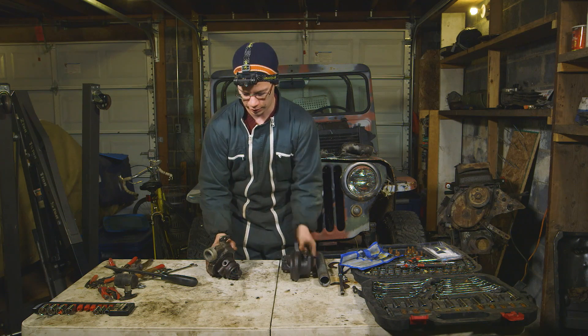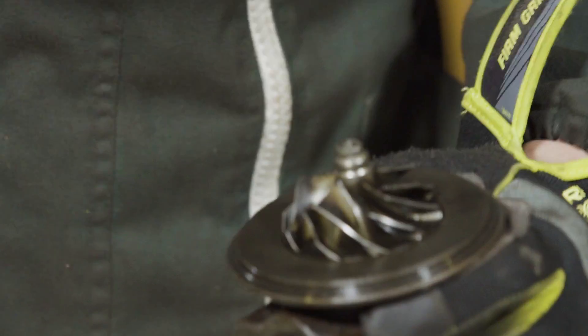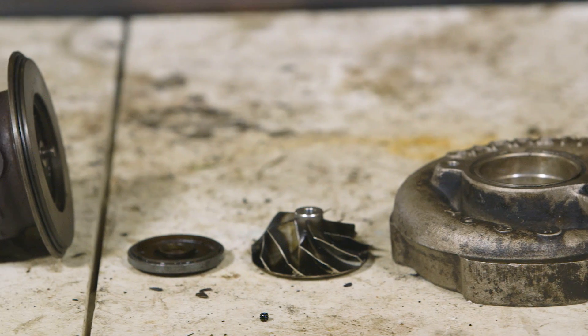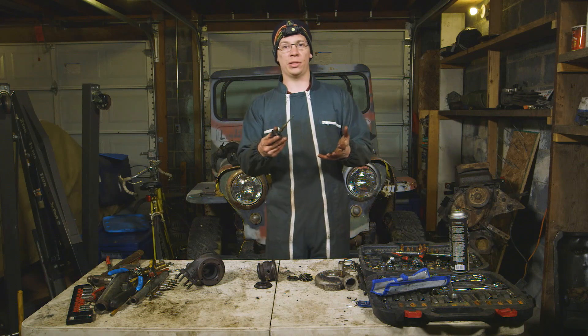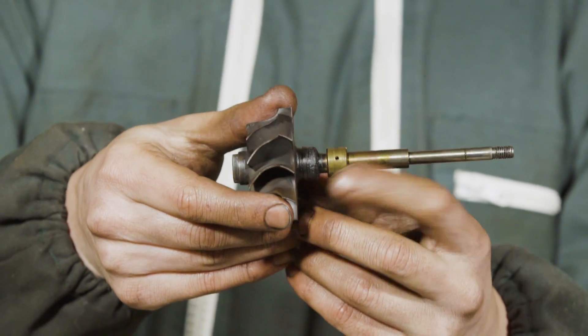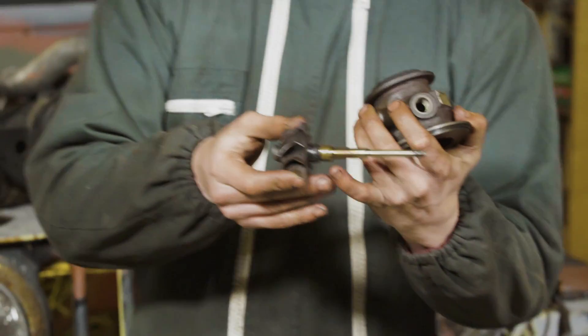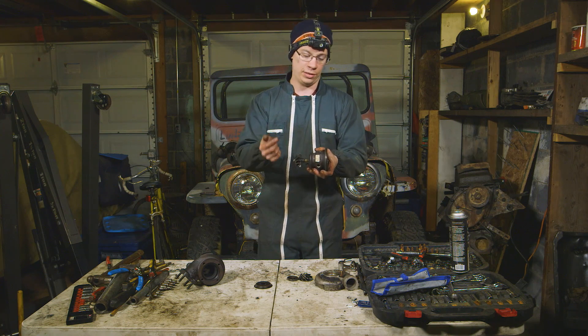Now that we've got a good look at both wheels, we're gonna take them both off the shaft and have a closer look at the bearings. Some turbochargers use ball bearings — this one uses journal bearings. It's essentially just a bronze sleeve with a bunch of holes drilled in it to allow oil between it and the shaft, so that the shaft can glide on a thin film of lubricant nice and smoothly. This turbocharger has two journal bearings — one on the shaft and one in the housing — and both of them are fed oil via this oil port. There's a little fork in the road to send oil to the front bearing and to the back bearing.